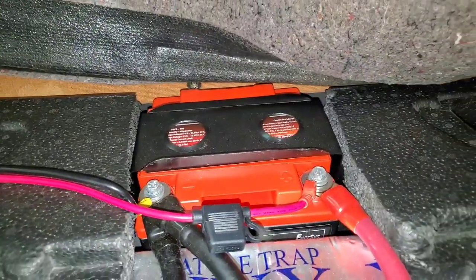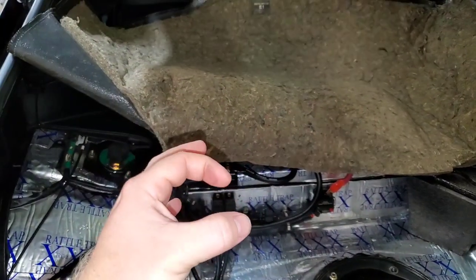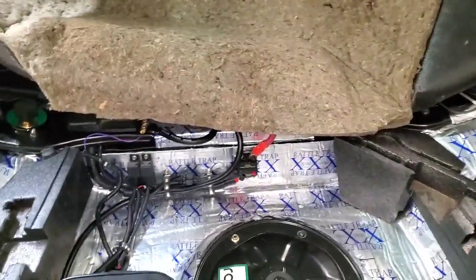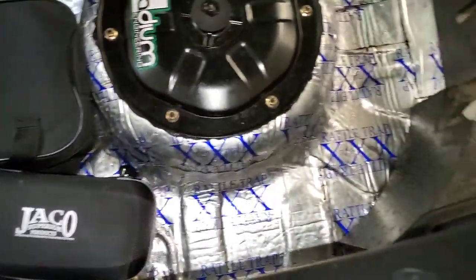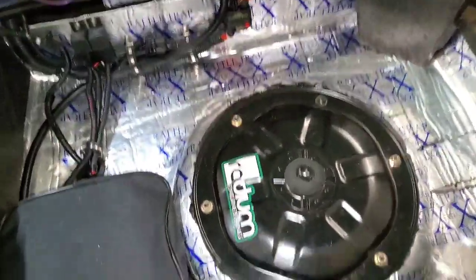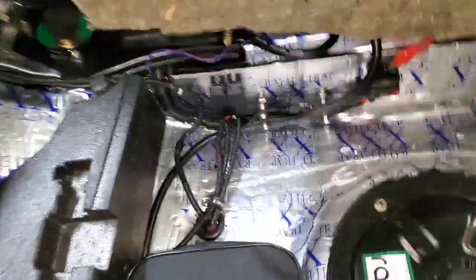It's a PC925 and what I've done is through-bolted it through the floor. I used pretty big washers — a rubber washer, a grommet through the hole, then a rubber washer with a metal washer, and a pretty nice size bolt. I think I used M6 bolts with nylon lock washers. That's given me lots of space right here, so I've got my tire inflator if I ever got a flat. Since I don't have my spare in here — I can't really run a spare with 19-inch wheels — there's really no point in even getting a spare tire.